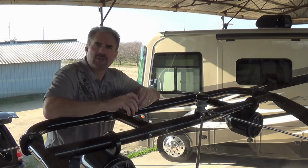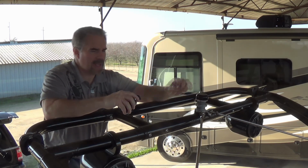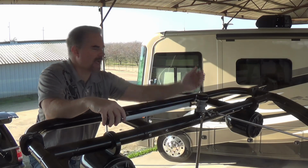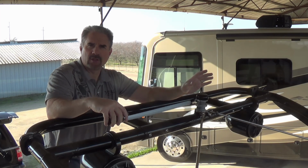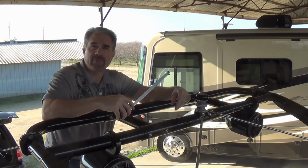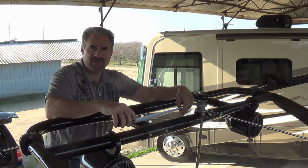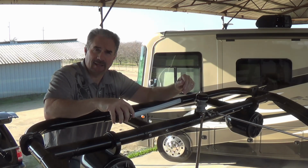Step 1, determine the mounting location. So start on your crossbar that's got your ski pylon, and what you're going to do is measure out on both sides. The tower tube rack is designed with 3 different mounting locations to try to avoid things like speakers or maybe some bolts that you have in your tower. Those 3 mounting locations are 18 inches, 15 inches, or 12 inches on both sides of the ski pylon.